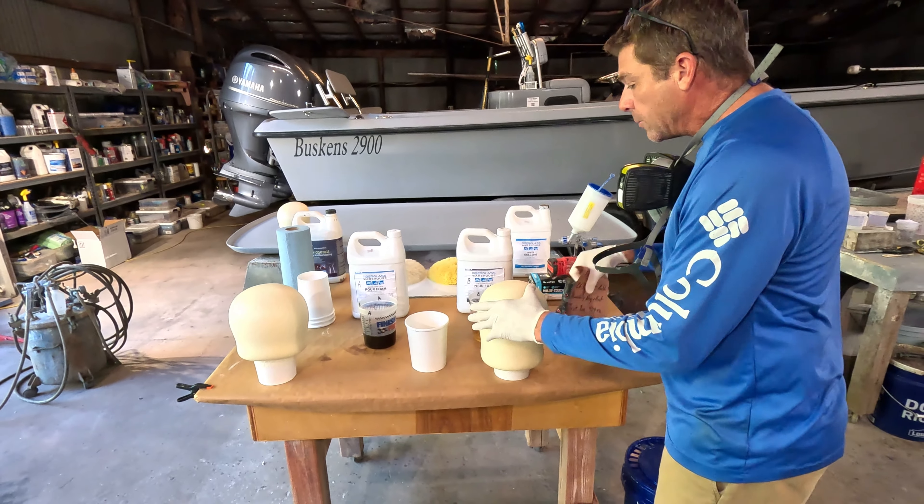The Coast Guard requires it. So if you've got an older boat that's under 21 feet and you start thinking you want to take the foam out, the builder could have put it there to add some strength, and legally it's supposed to be there. You could make airtight chambers underneath — which is actually what we did when we built our 29-footer. We did not put foam under the floor because I'm not required to, but we had a whole series of airtight chambers. The problem is, if you rupture a series of those chambers, water can still get in them. Whereas with a foam-filled cavity, water can't get in in the event of an emergency-type situation.